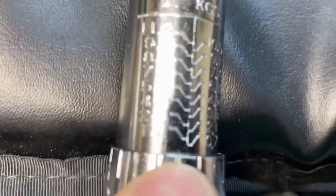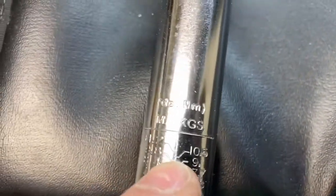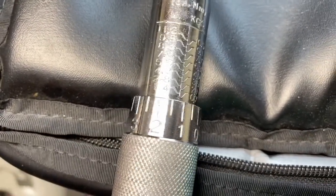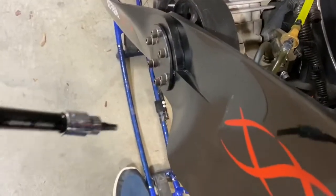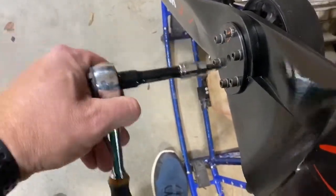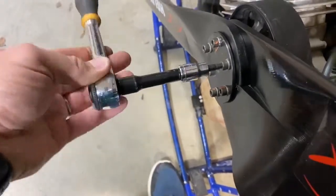We want the newton meters side, not the foot pounds. Just in case you're new to torque and torque wrenches - everything will start off at zero. You have these lines right here, and you look on each side and see the ratings. We want about 10 newton meters or 10 and a half. So we're going to go to that line right there. When the zero reaches that, just keep turning it all the way up - and that's right in the middle. I'm going to put this between my armpit and use a regular wrench, and snug them. My bolts have already been hand-snug, so very lightly I'm going to tighten these down.